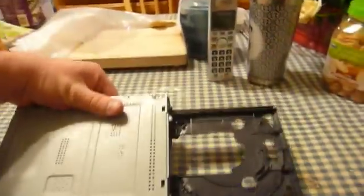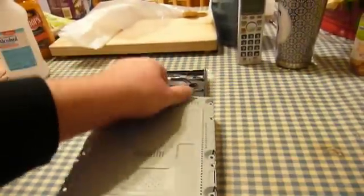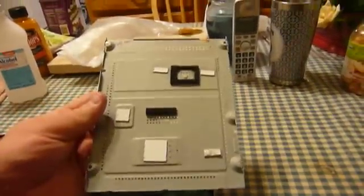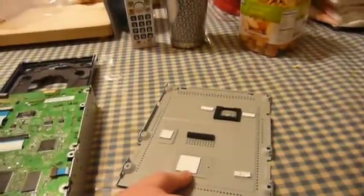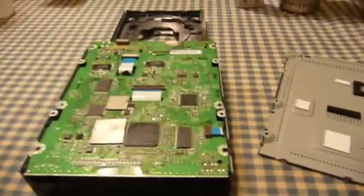When you've done that, you're ready to take the bottom panel off. The bottom panel will be held by a couple of screws — I already took them out on this drive. And without too much swearing and hopefully no cutting of our skin, this thing should go ahead and come off. You'll notice right away one thing to be careful of: there are heat transfer pads that go against some of the more important chips in here.